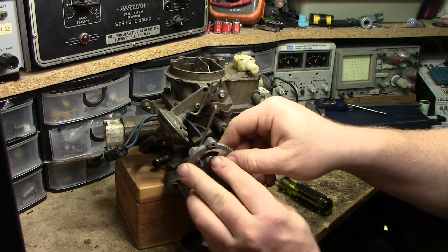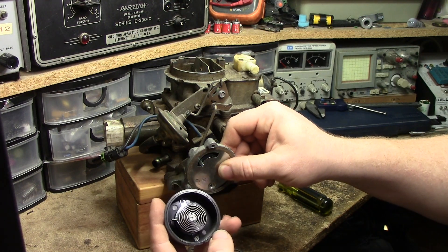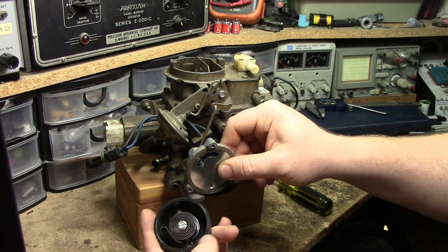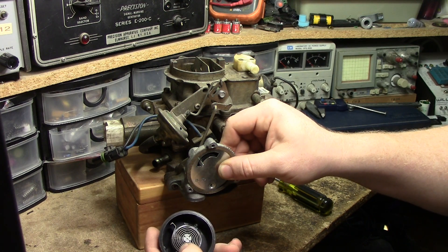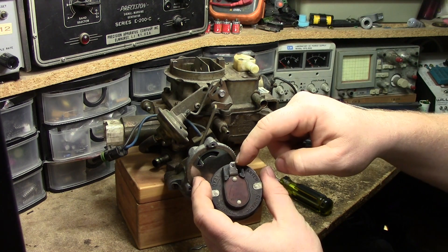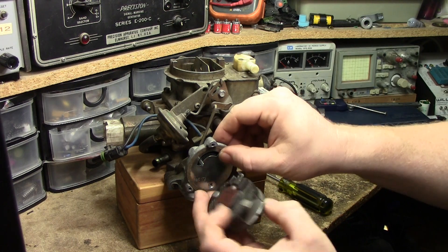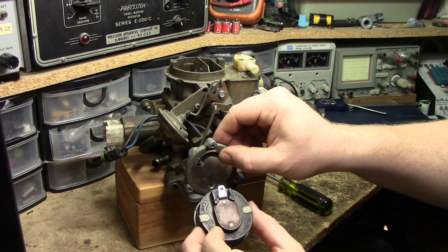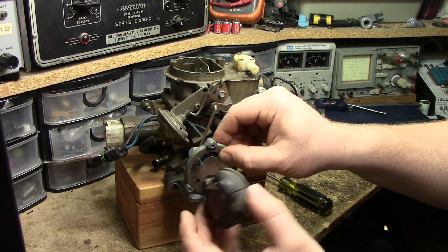And this has a full range of travel from here across. We have a single gasket. This is the electric choke itself — some people call it the electric choke thermostat housing, sometimes just the electric choke housing. It's a bimetallic strip in here that DC power travels through, and it grounds through the carburetor housing through tabs on either side. It says 'lean' somewhere on it, but this one here specifically is made by Carter.